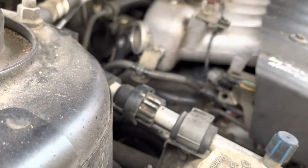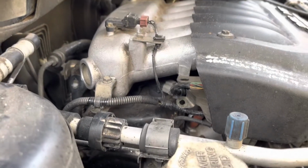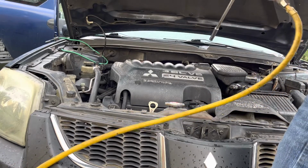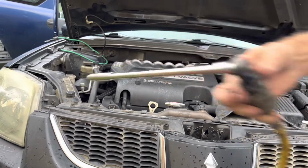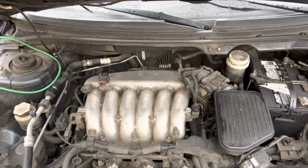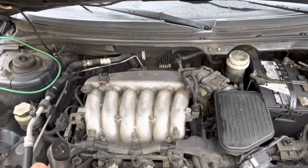Now, because I'm trying to be quick about this, this car is hotter than fire right now. Kid just pulled up, put this fan on there, to try and suck some of the heat away. It seems like the fan has helped quite a bit. Hold the bucket. 10 millimeters on this plastic cover, I think. Cool little wrench, but it's really loud. Switch over to the 12 millimeter. These are all 12 millimeter. 1, 2, 3, 4, 5, 6, 7 bolts. Hold that plenum on.